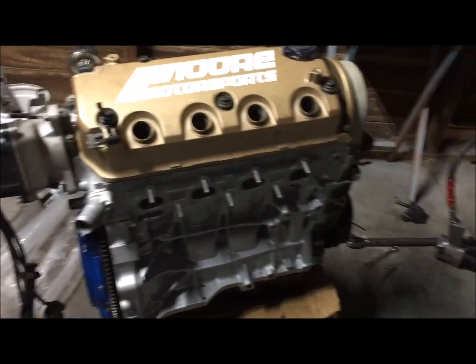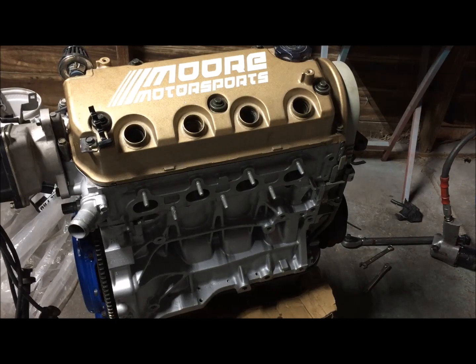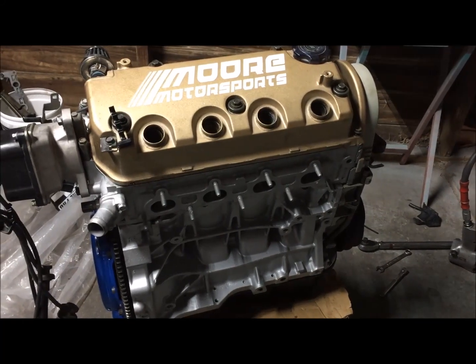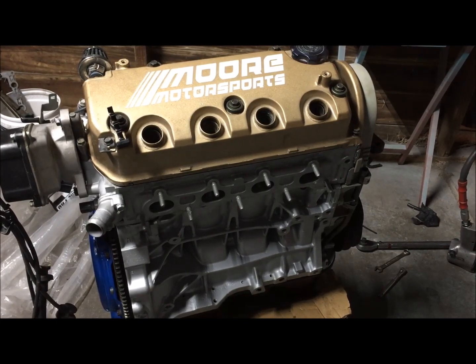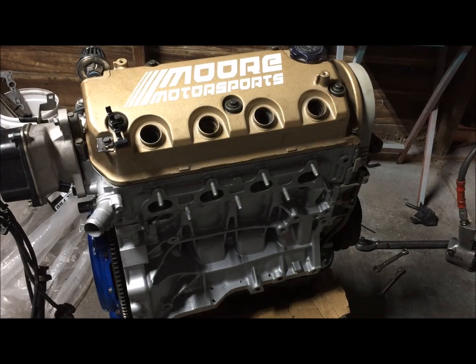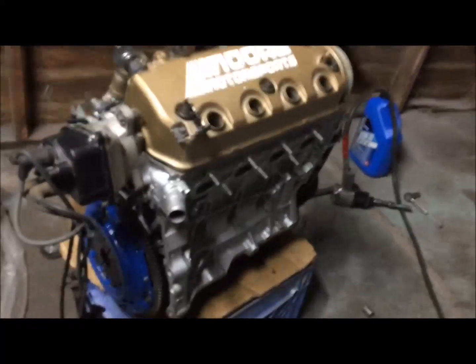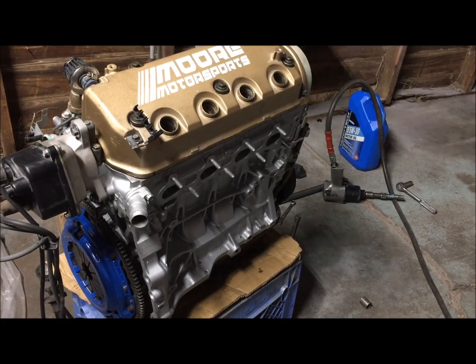And don't rev it high. A lot of people say drive it how you're going to drive it. I've tried that and it does not work. The way it works is the way that the factory manuals say it's supposed to. You're supposed to change it out at 1,000. There's a lot of research that I've had to do on actual engine break-in to get a properly built engine. This isn't my first, and it's definitely not my last. So stay tuned, everybody. I'm about to put it in.